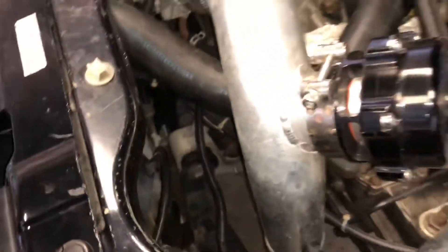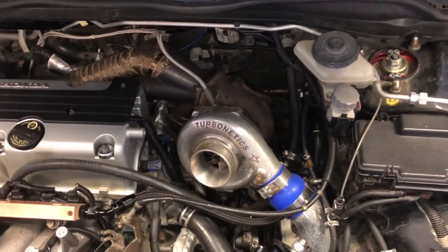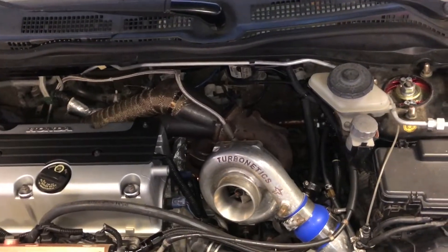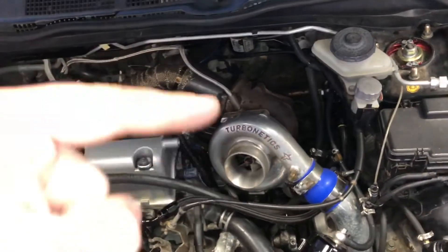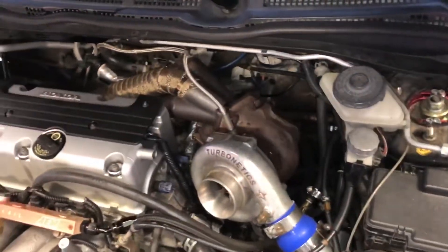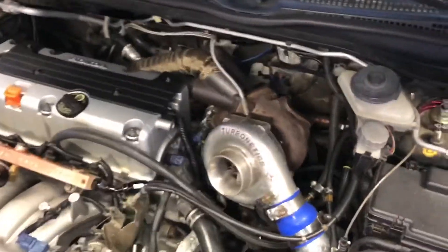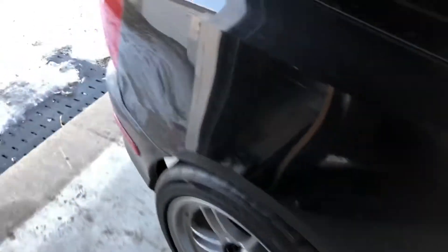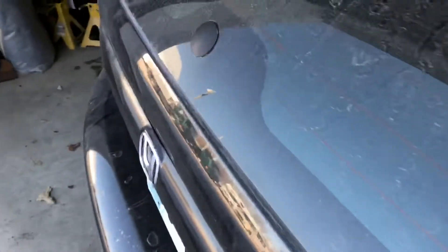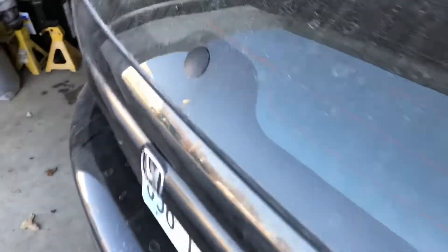I ordered those Energy Suspension inserts. The car is three-inch straight pipe all the way back, and when it gets to the axle-back it goes down to two and a half inches. The downpipe is two and a half inches. They have no flex pipes anywhere on this exhaust — it's all hard mounted. That's probably why the turbo manifold cracked, because of the hard mounting. I plan on putting a flex pipe in there. I also ordered more fender washers and a new rear wiper delete — it already has one but I don't know the brand, so I just ordered a new one.